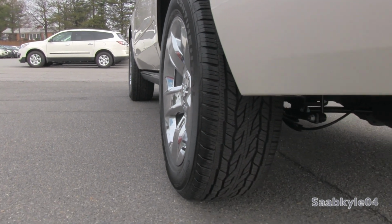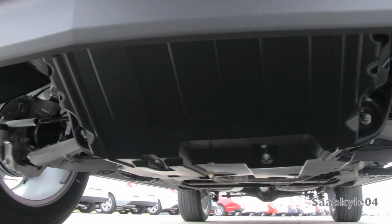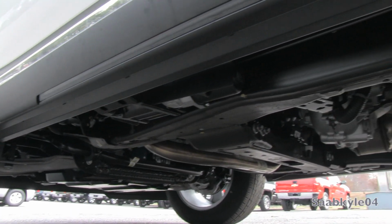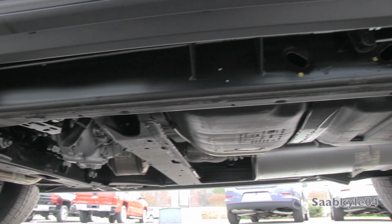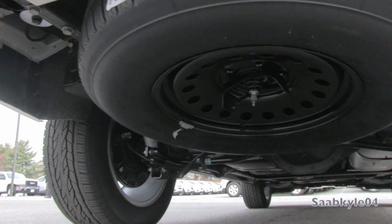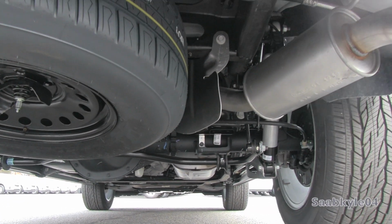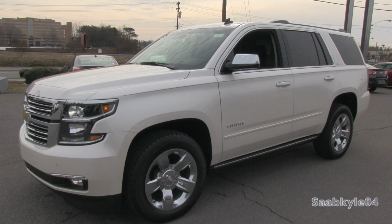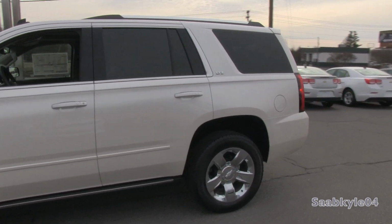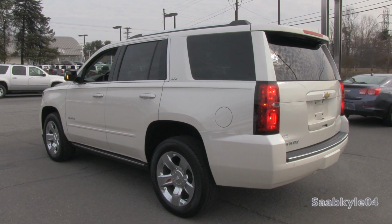Being a body-on-frame SUV means the body and powertrain are bolted on a fully boxed, hydroformed steel frame adapted from the Silverado, for the Tahoe and Suburban. The suspension and chassis have similar designs to the last Tahoe, but have been heavily revised for a quieter, more controlled ride. It consists of independent double wishbone coilover shock front suspension with twin-tube dampers and 34mm hollow stabilizer bars that increase strength and decrease weight. The rear is a traditional solid axle with leaf springs and tuned dampers with revised bushings to help soak up bumps. A simple traditional setup for pure truck stuff and rugged performance.